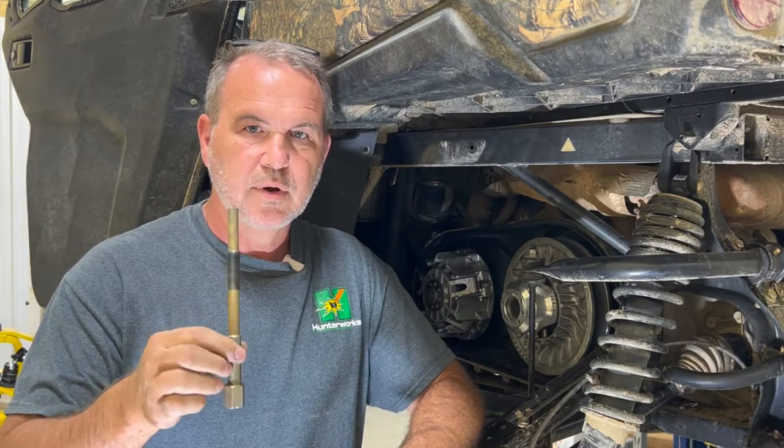Sometimes I think these videos are a little crude, but you have to consider where we're at and what we're working with. We don't always have the exact tool — I wish I had a short 22 millimeter socket, but if we showed you 100% everything perfectly professional, you may not have it at home. We're just like you and we work with what we have sometimes. I'm big on impacts in certain uses because I'm lazy — sure does make things move along quicker — but these Can-Am clutches really do need to be torqued properly. That's why we came out with our holding tool. We'll have a link below for that tool and for the puller.